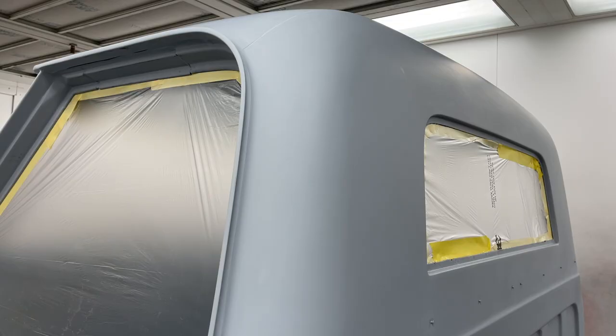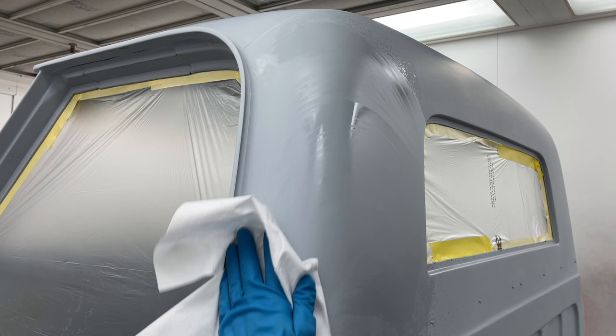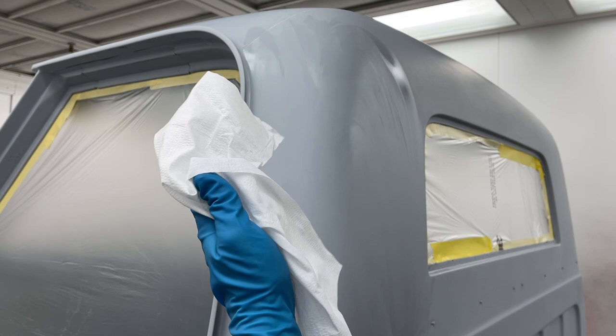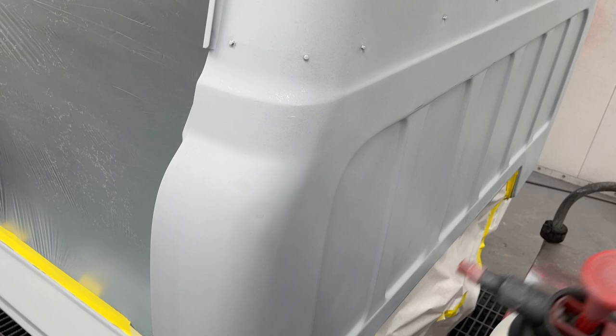So when I'm cleaning with the waterborne cleaner, I spray it on and I wipe it off, right? You don't want it soaking wet where it saturates the towel and you're just smearing it and it's still wet. You want to spray just a little bit on, enough to get the surface damp, and then wipe it off. And I use one towel at a time, usually a panel. If it's a big panel, half a panel. Once that thing is saturated, it's gone. It's time to get another one. So we'll mist it on. Wipe it till it's drying behind the towel.